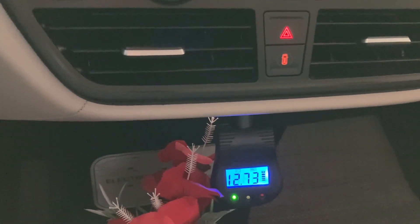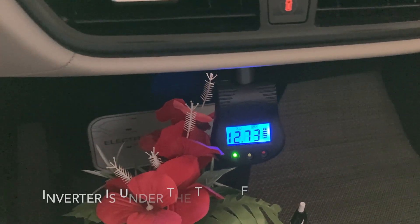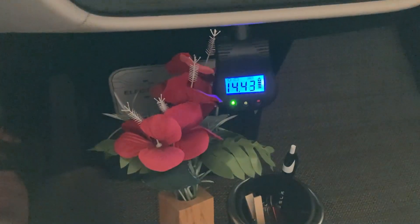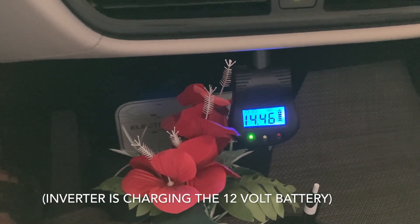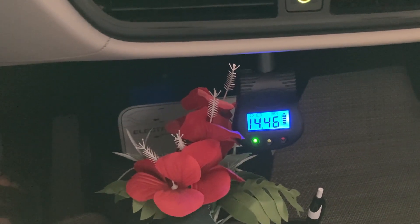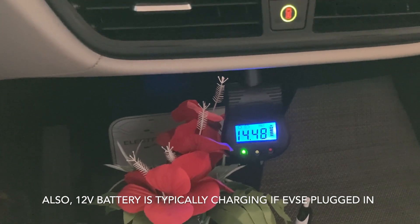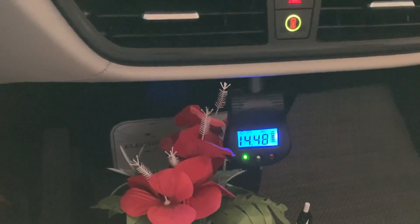You can also, once you start it up, see the inverter power up — the voltage output that goes to the main 12 volt system bus. We'll go ahead and turn it on quickly, and in doing so we can see the voltage now jumps up to about 14.40 to 14.50 depending on conditions, which is now charging the battery using the main 400 volt lithium battery through the inverter. This is a way to monitor that the inverter is actually giving sufficient voltage to charge the 12 volt battery, and gives peace of mind that that system is working correctly as well.